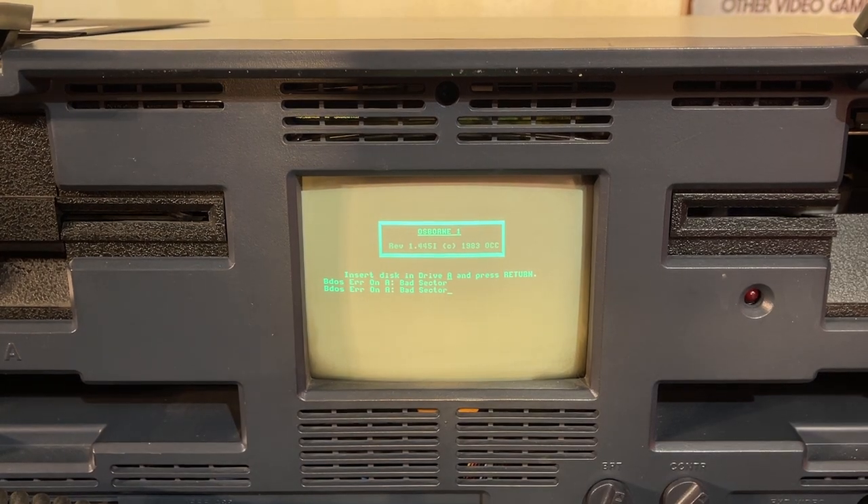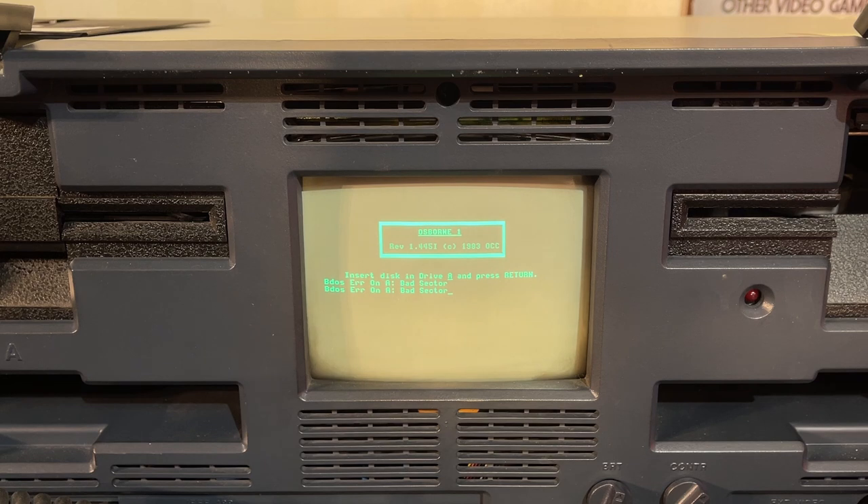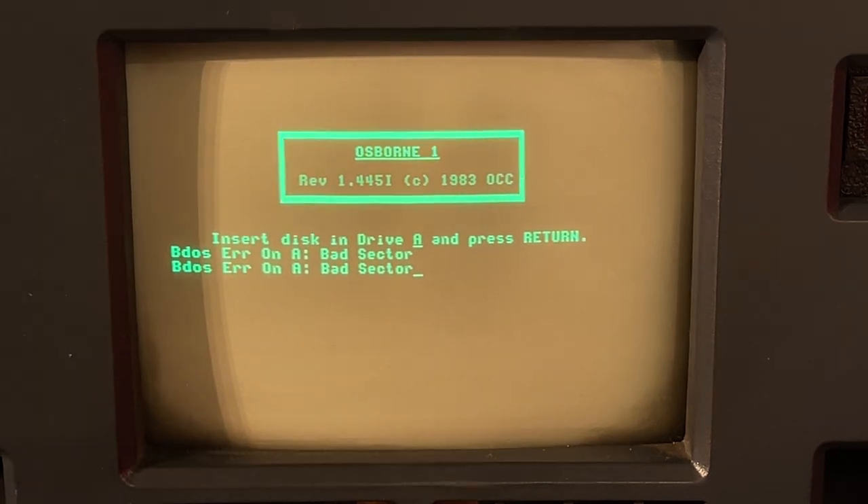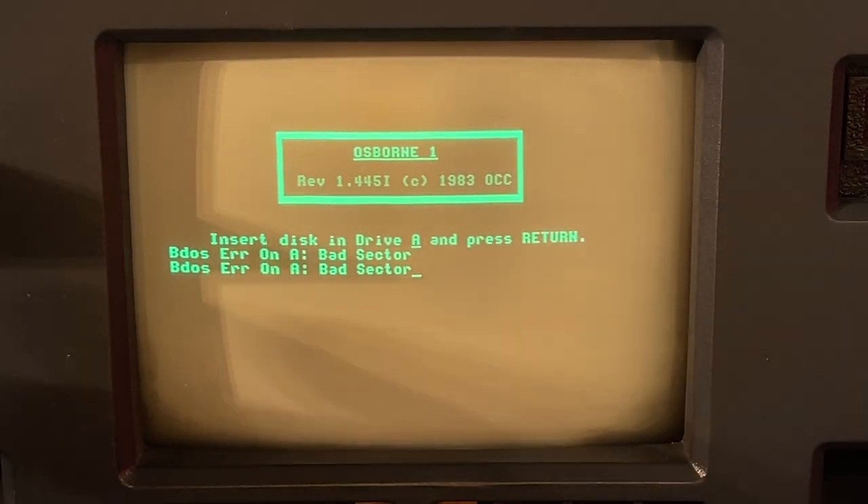This has a built-in power supply so I guess it has some RIFA filter caps. Let me try and boot this one — it also says bad sector, still a read error. That means we can't boot this machine. I need to find another floppy disk. I think I've got a CP/M diskette from my Tiki 100 machine — I'm not really sure if it's the same format but it's CP/M compatible at least, so I'll try it anyway.